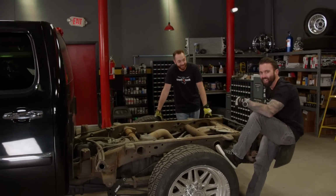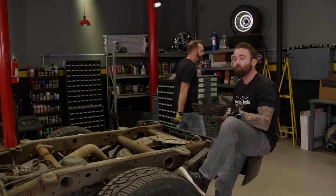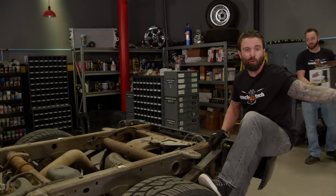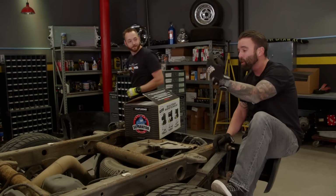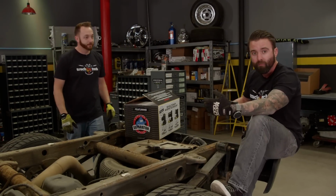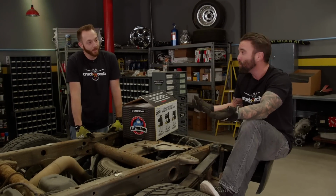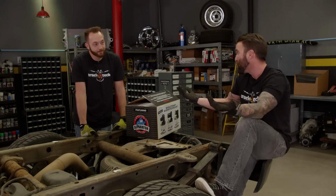When you're talking Duramax, what you might not know is that it wasn't until the L5P that they actually installed a lift pump in the fuel tank. That means from the LB7 to the LML, they had none. So that factory CP3 and CP4 is pulling all that fuel from the back, bringing it up front. And that's good for about 500 horse, but when you're talking serious horsepower like we want, it'll be starving for fuel, you know?